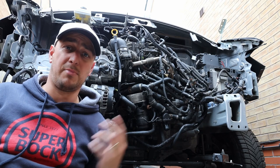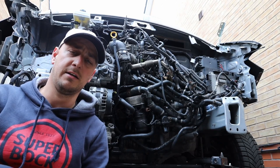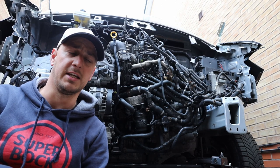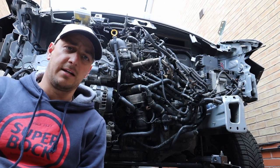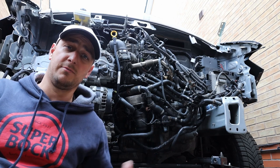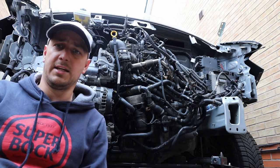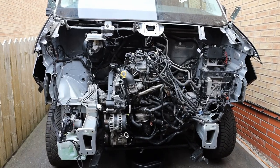I spoke to VW and the parts are available. We had a go at straightening the chassis with the engine in by pulling it with a pulley - it didn't go well. This is obviously a home job for taking out the engine; I believe the correct procedure is to take it out from the bottom, drop it through, but as we haven't got a front end on here, no bonnet etc, we're just going to lift it out.